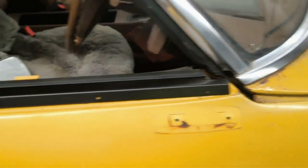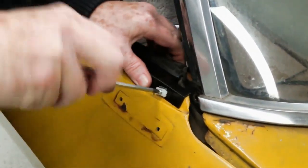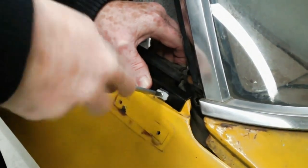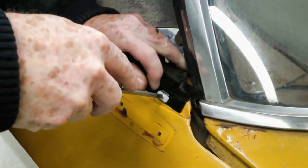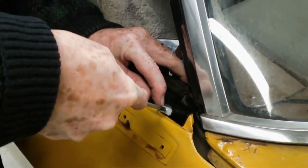Once I've got all the screws and clips in, I'll then put the moulding on. What I want to start with — I'll just open that door, bring that up here. Now, as you can see, you'll see how it's high through here. So, first thing, I'll put this front clip in. It's important that you make sure that the clip finishes it up nice and straight.